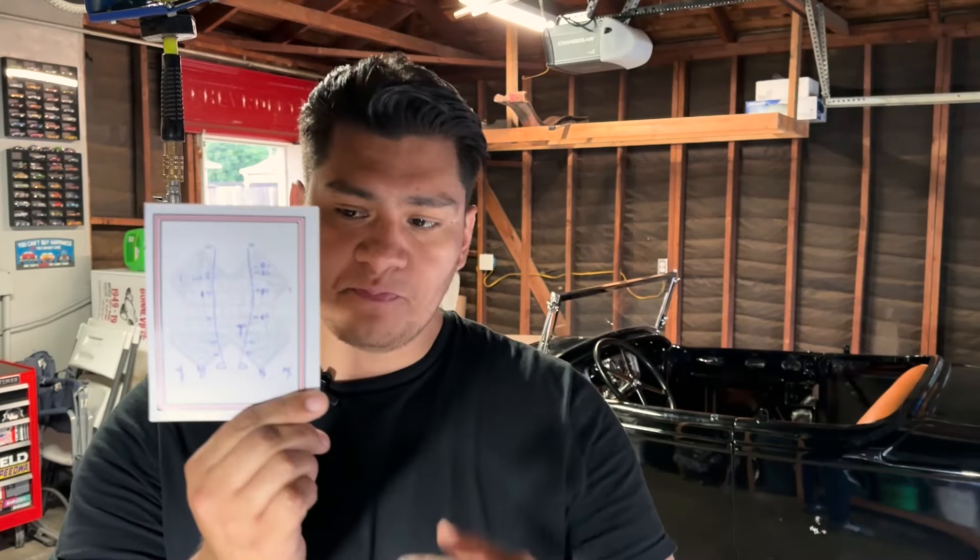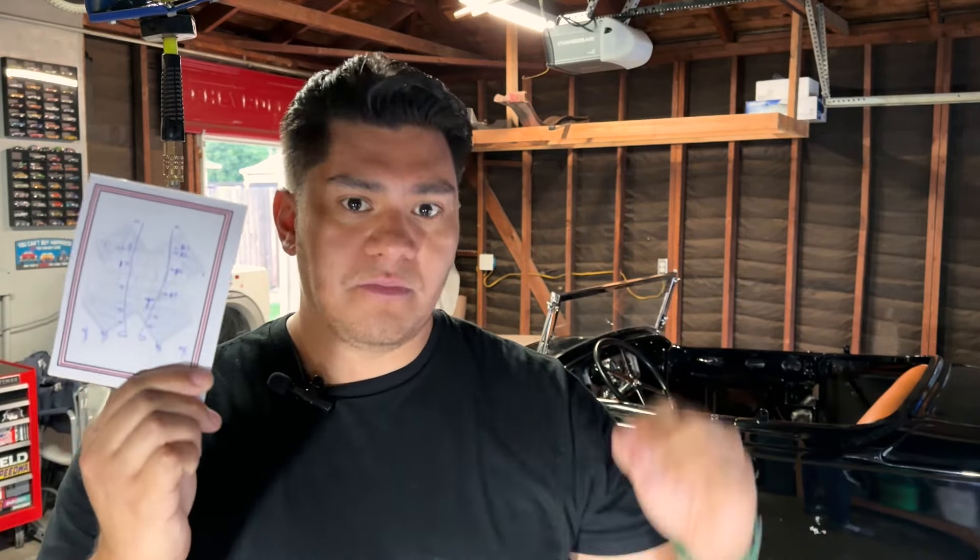Another thing I recommend is to make yourself a little diagram of your body and its holes, and how many shims you end up using. This comes in handy in multiple ways. Let's say you slide three shims in there, go back to adjust, and two come out — was there supposed to be three, or four? This helps make sure no shims get trapped in spaces you can't see. It also helps if you want to go a little tighter on those cow feet — you can take a thirty-second or sixteenth shim all the way along the body and everything should still line up. So do yourself a favor: write it down and add tally marks for what shim you used and what size.